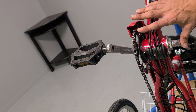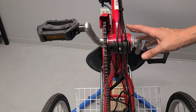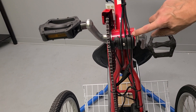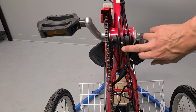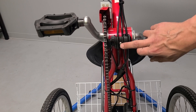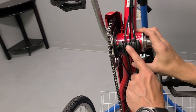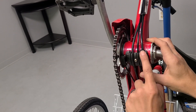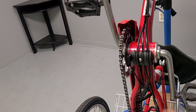We put that on in advance when we remove the crank arms and everything. Once the crank arms are removed and the magnet's installed, we're going to want to find center and parallel center of the bottom bracket cage. You're going to drill and tap — it's going to be 11/64 drill for a five-millimeter tap. On this bike we have built-in wire guides, which is a lot nicer and holds everything together neat.